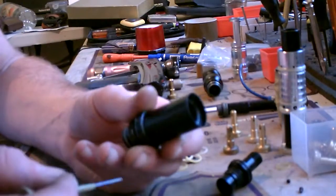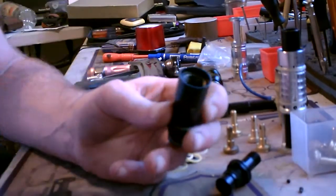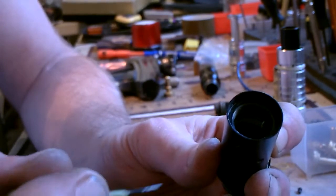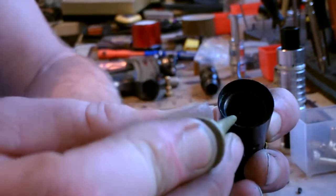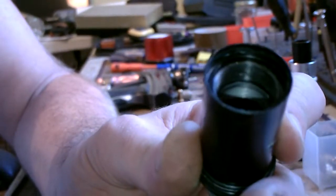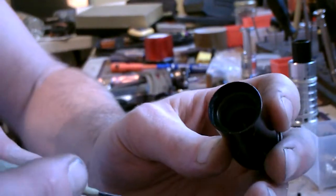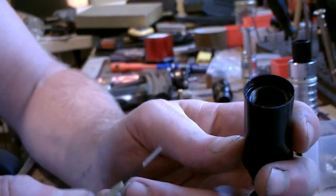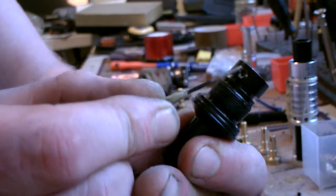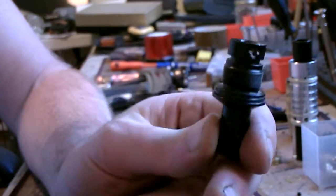So that's another bit of a mystery from your gun. What I'm planning to do is take this into work, pop it in the lathe, and see if I can polish this damaged area out. See there's a silver area in here — well it shouldn't be silver. That silver area, it's not a smooth surface, it's a torn surface. So I'm going to polish that out, then spin this and touch these so we can take the damage off of there. Then I've got to find a slightly bigger o-ring to go in here — if I can do that then I might be able to save this regulator.